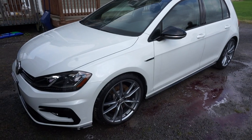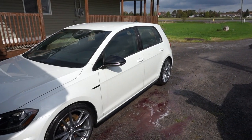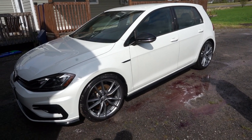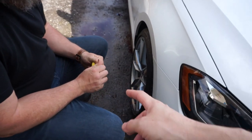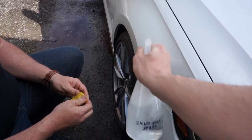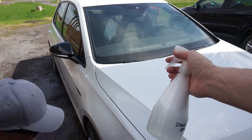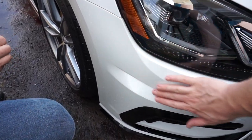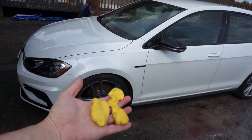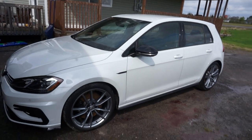The spray-off is now complete, so now we're ready for mechanical decontamination with clay bar. Here's all the iron that I got out of the car — it's all on the ground now, and the white is looking a little bit whiter. We've got many more steps to do before it's done, so this is not even halfway there. Now we're on to mechanical decontamination. This is a brand new clay bar, and I'm using some car soap as lubrication. You always want to keep the surface of your panel very wet, then you just rub the clay on it and it picks up all of the embedded particles out of the paint. After using two pieces of clay over all the paint, it's pretty good after the chemical decontamination.